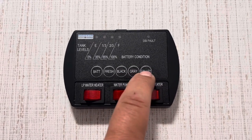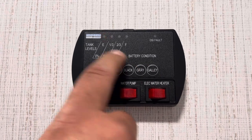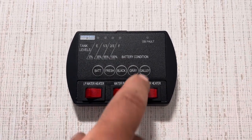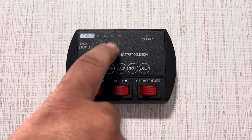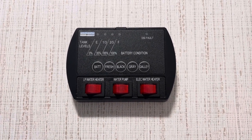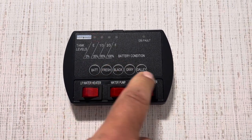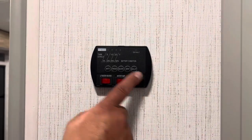If any of those three tanks get full — at one-third, two-thirds — the light will indicate when you're getting close to full and when you're ready to dump. I always recommend waiting for the tank to reach about two-thirds or full to dump it, so pressure pushes everything out. The more pressure the better, but stop using the toilet or any of the other tanks as soon as it reaches full.